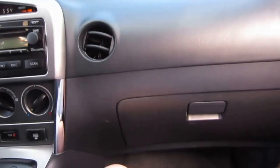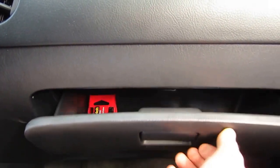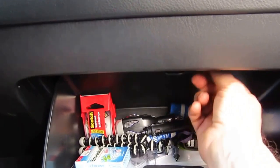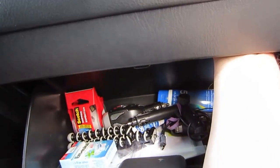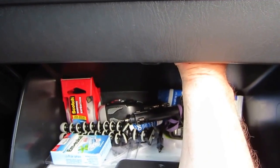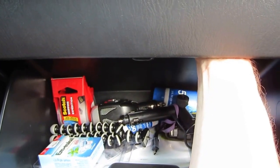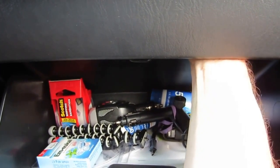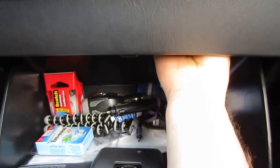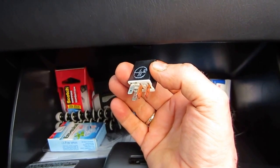Thirdly, you also need the relay, and that took me a while to figure out. I originally only had the outlet and the inverter mounted, but that didn't work until I figured out there was a relay hiding in the relay block right behind the glove compartment. If you reach up on this side you'll feel the relay block. Your Toyota Matrix will have two relays on the far left, and the far right slot is empty — that's where the relay for the power inverter goes. That's the relay you need, so make sure you get that from the scrapyard as well, otherwise the whole thing won't work.